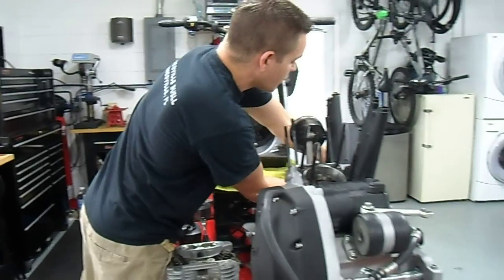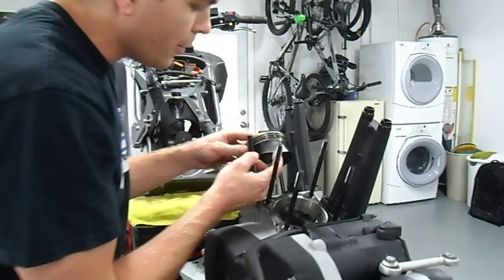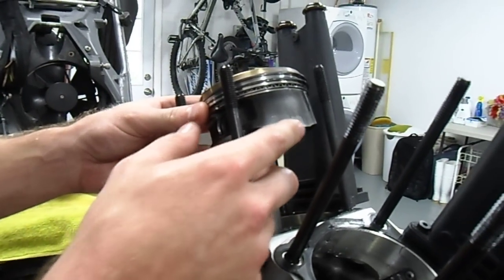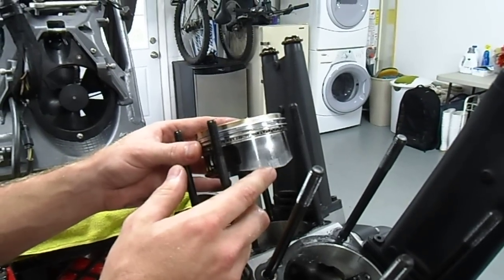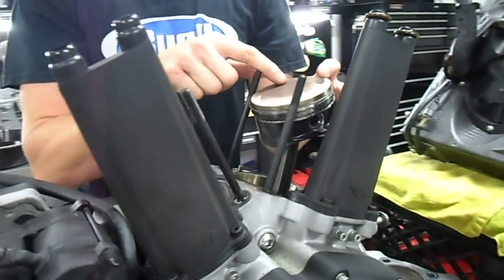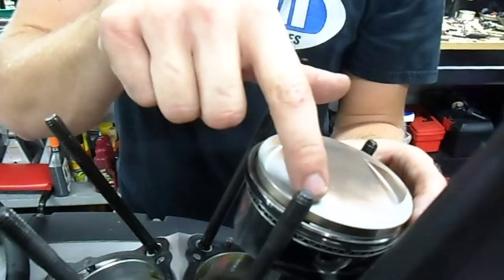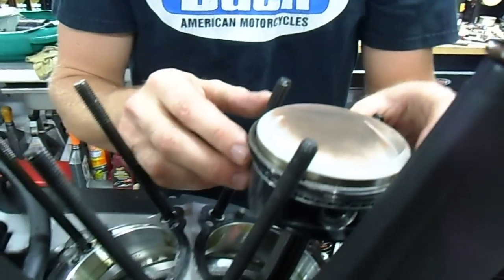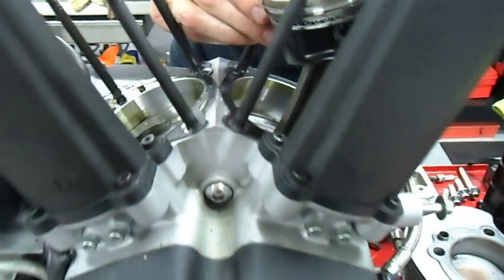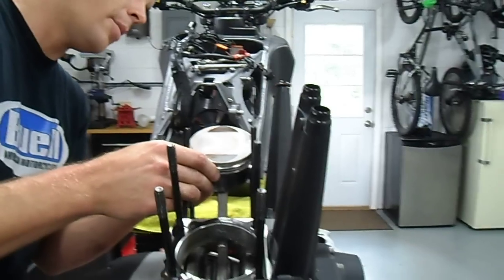Of course, there weren't that many miles on this motor. The piston itself has some damage to the bottom of the skirt and this antifriction coating is actually pretty well worn off. I may have had 600 or 700 miles on it before I did the dyno work. This copper color is the thermal coating, and on the right side of the motor towards the pushrod side, it looks like the coating is completely gone. That's either an issue with the coating quality or could have been a combustion temperature issue.